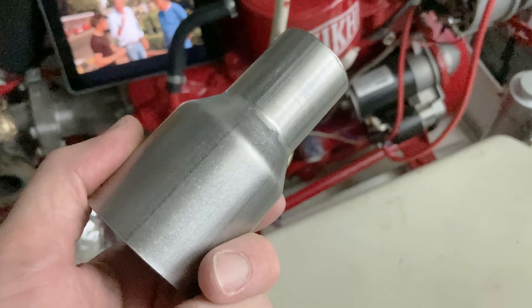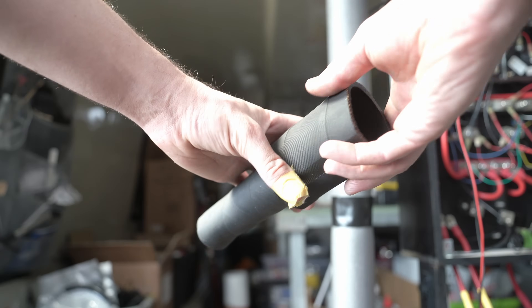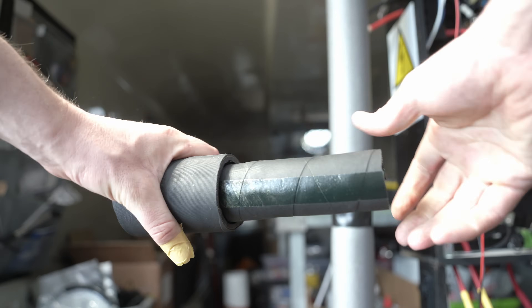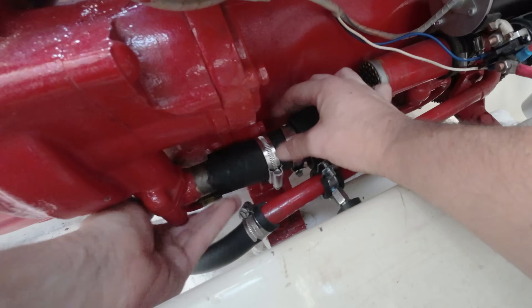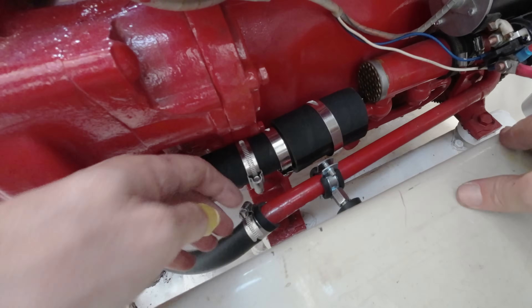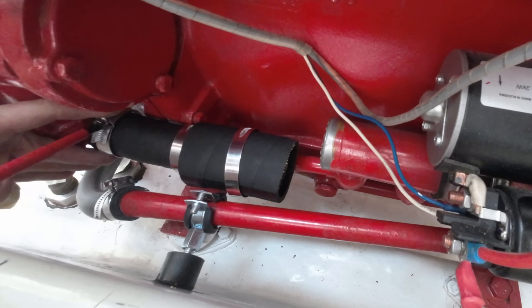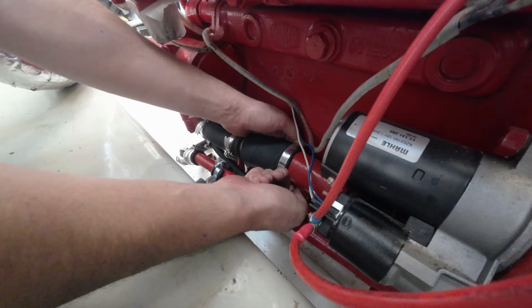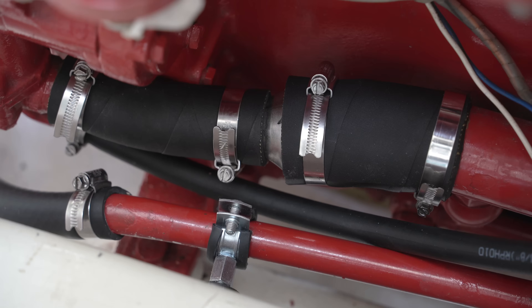To start, a custom reducer I asked a magician on eBay to make for me. Space is limited in the area it's to be fitted into, so I've slid the hoses over the reducer overly far, and then once in place, I can shuffle them outwards to extend the length and fit over the metal inlets and outlets. It requires a little pre-planning so that all the Jubilee clips, fine to use on these wider diameters, are in place before sliding one end onto the engine. I can then shuffle the hoses along to get as much overlap as possible, and then do up all of the clips.